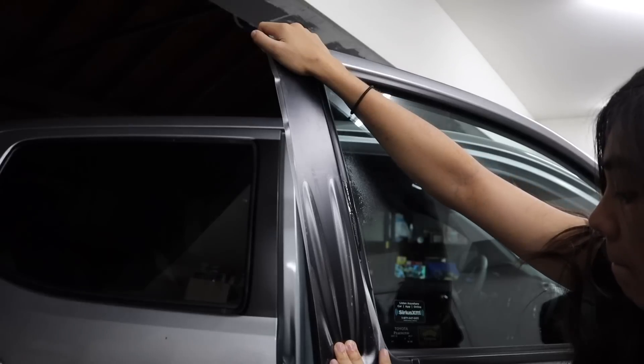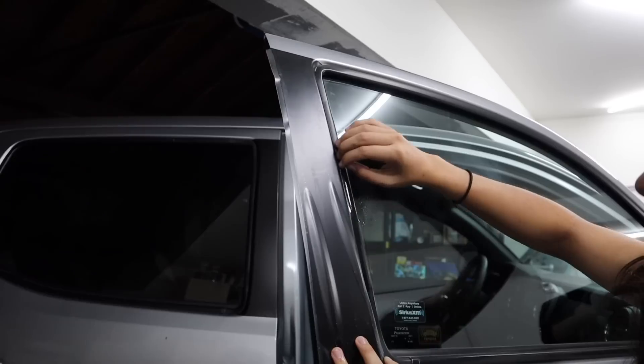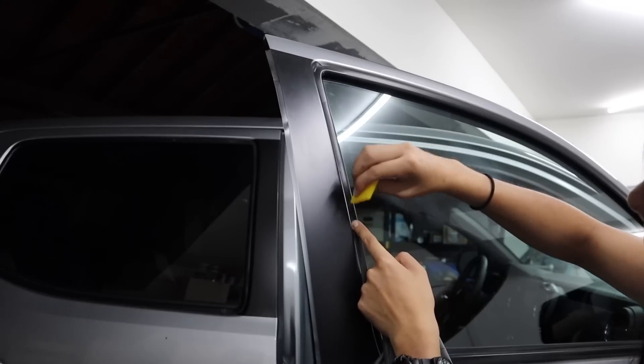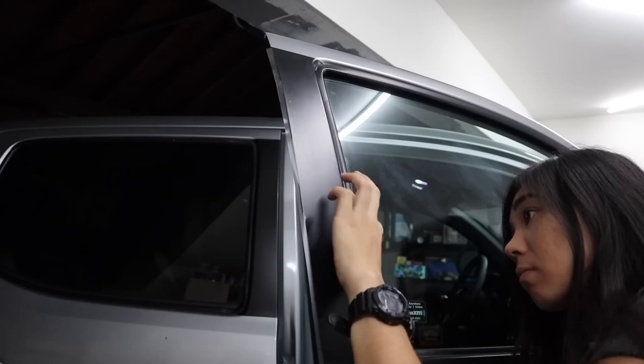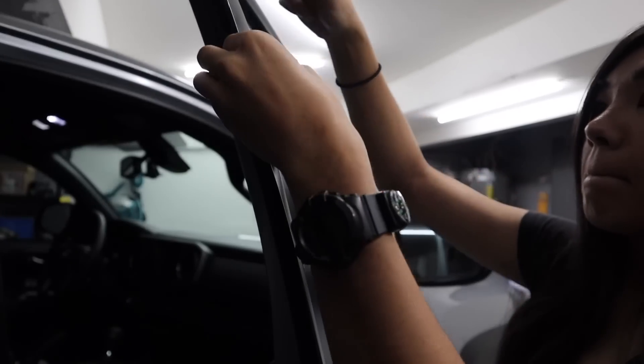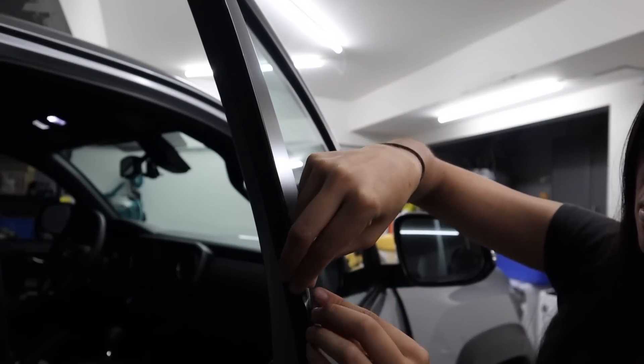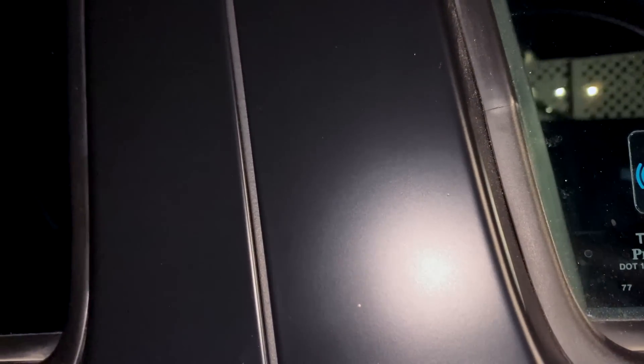I do the same thing as with the other pillar where I pull down the film to line it up with the bottom. For this one, you'll notice that you have some overhang of the film from the door — and that's good, that means you lined it up properly. The reason they're designed like this is because people that tend to use this film are people that use their trucks on the trails and are often washing their trucks. Scraper Tech made it so that the pressure washer couldn't take off the film, and it also just looks cleaner and like the film's not even there. If you have trouble getting it to stick, I find it more helpful not to use the spray bottle — just let the film dry and it becomes stickier, then you can fold it over and it'll actually stick and stay. Here's the final result — this clip was taken right after I applied the film so it looks a little bit dirty, but the next two clips were two weeks later and I think it came out great. I shined a really bright light and tried to see the old scratches and I couldn't, which was great. Overall I'm very happy with the result.